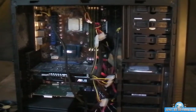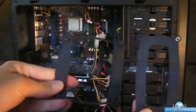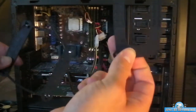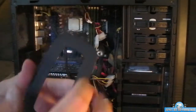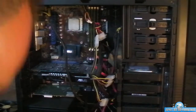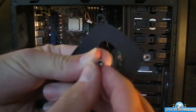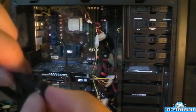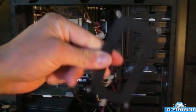Okay guys, this is what we're going to do. The instructions say to prepare the back plate. It comes with two different back plates - this one and this one. My motherboard is going to use this one. I'm running an Asus AMD M4N72E motherboard. So this is the backing plate - what you have to do is pop in these little ridged pieces right here. And you just pop it right on in. All four are in there, nice and flush.